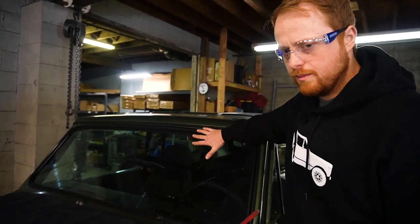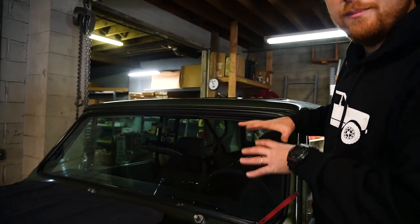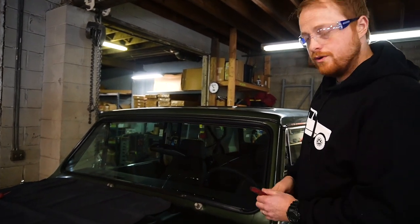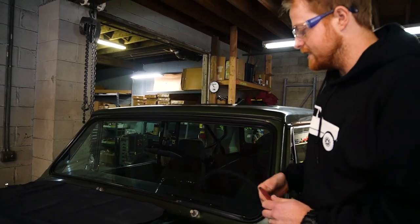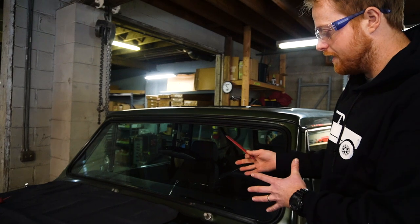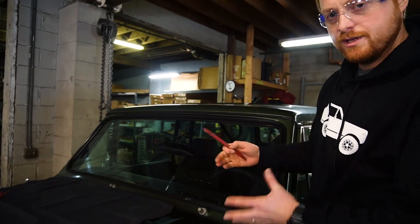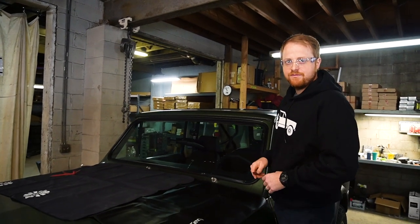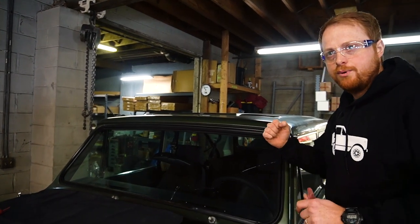On an older windshield seal it's going to be tough, hard rubber, so you're going to want to use a utility knife. You don't have to be as gentle with it — you don't have to use a plastic tool when removing the windshield. You do want to wear safety glasses just in case the glass chips out at you; you don't want glass in your eye. Getting the windshield glass out, just protect your dash and protect your truck and get it out of there — it's no real magic to it.